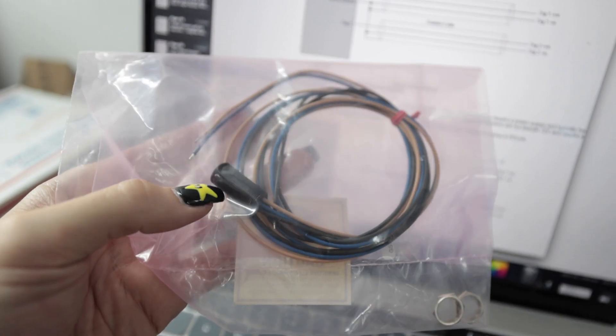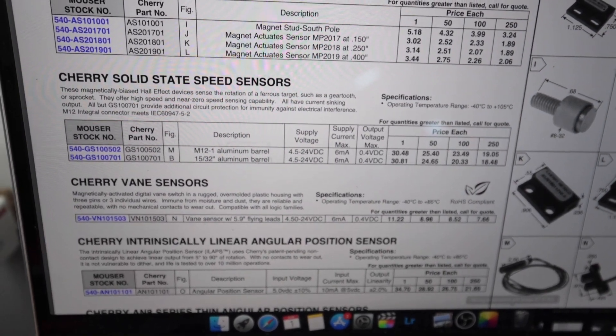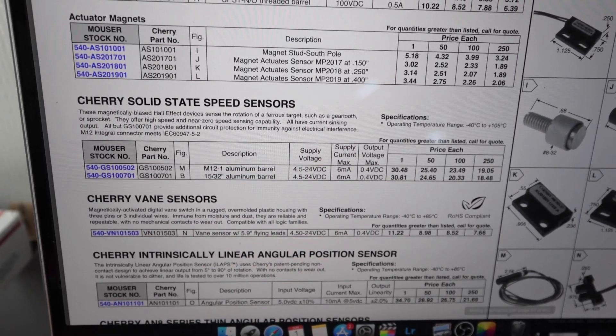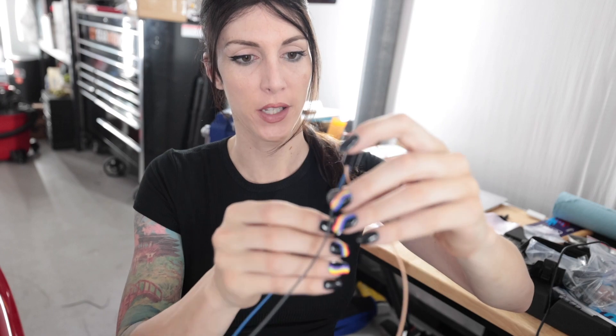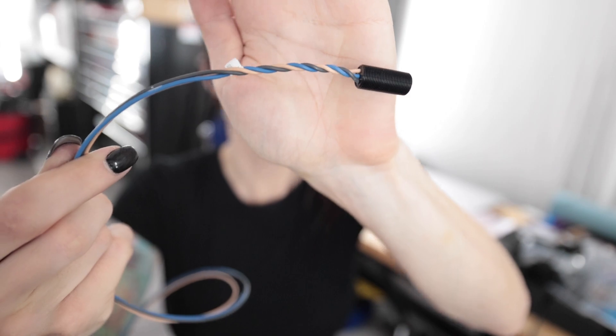I haven't wired up the cam trigger yet because this thing is a little tricky. It's a three wire system — hall proximity sensors. I have a trigger and a sensor ground, and then it's going to require a power source that is a varying DC input, and that's what I have to determine. GS 100701 — 4.5 to 24 volt DC input. So I have a wide range that I can send from the ECU. Because this is a hall effect sensor, it needs to be a twisted pair. That's why the rest of the wiring is shielded. I would rather have a braided pair than a twisted pair just because it looks cute. Twisted pair. I like that they have different colors that kind of work together.